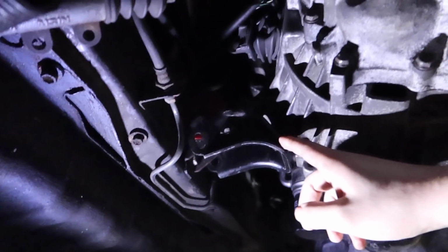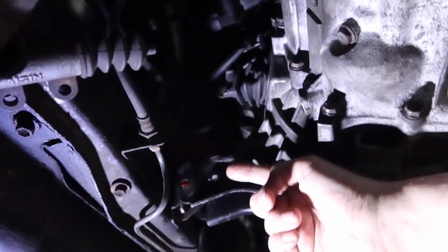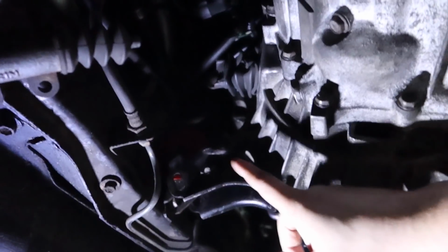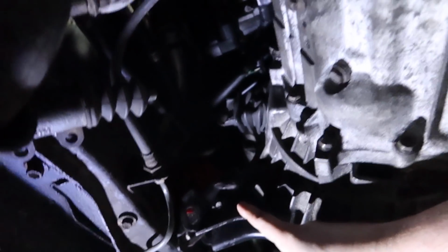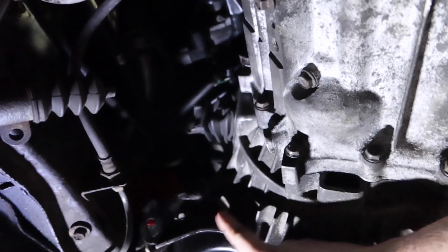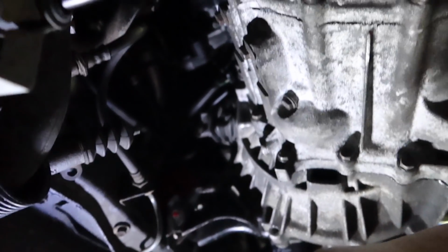We're not going to get any focus. Well, I can show you this one. I left this engine mount on thinking I'd wiggle it off, not realising that obviously it has to come this way before it can wiggle. What a fool. The reason I left this is because this is the one that's notorious for pulling threads, and I have helicoiled one of them. There's 2 bolts up here. I have helicoiled one of them already and I didn't want to do it, but you can't get it off because it needs to come this way, Dan, you fool. This way, this way.